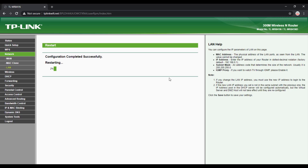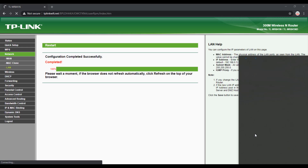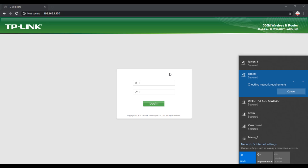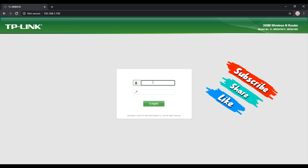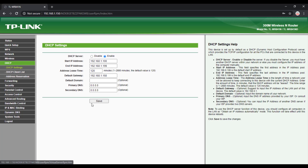You can skip this IP change step, but if you want to log in to this extender router remotely, you need to change it. Otherwise you would have to physically reach the router and connect a LAN cable to your computer, because the extender router's default IP address is 192.168.0.1 and our network is 192.168.1.0. It's better to change it to the same subnet so you can log in wirelessly. Now the last very important setting: connect to Wi-Fi network SpaceX and type 192.168.1.150 in the browser. Since we are using Access Point mode, all devices will be in the same network and the main router acts as DHCP server. Two DHCP servers on the same subnet will not work, so go to DHCP server settings, disable the DHCP server, save the settings, and reboot the router.